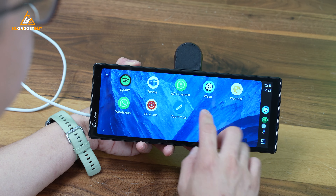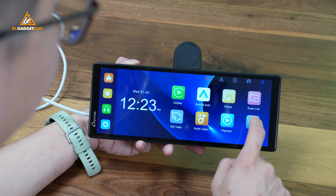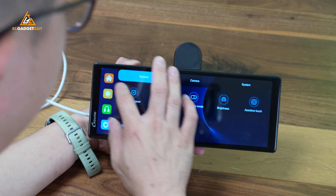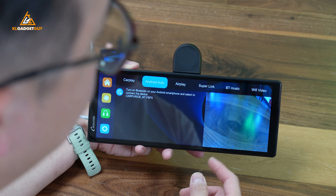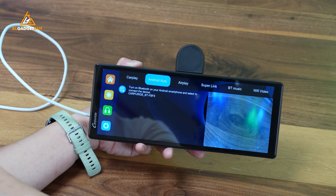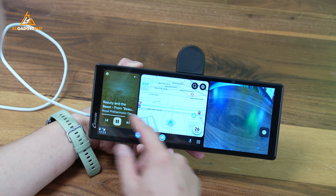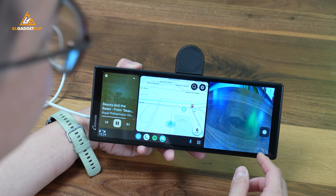How about if I change it to half-screen mode? Let's head to settings, general, split-screen mode, and then back to Android Auto. It's going to restart obviously, but you can already see that the camera screen is on the right pane. This is how Android Auto looks on split-screen. Personally, I would rather have it take over the entire screen because having the camera on the right side just feels weird and it's not in a proper aspect ratio.